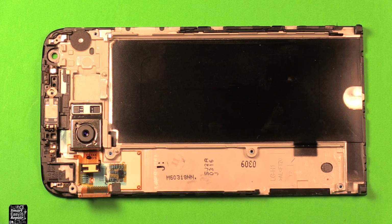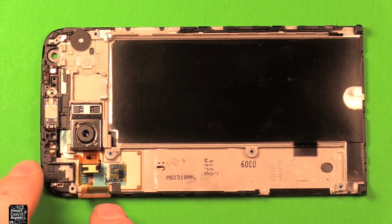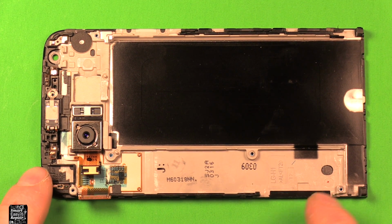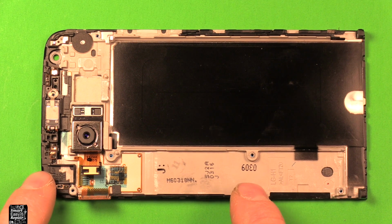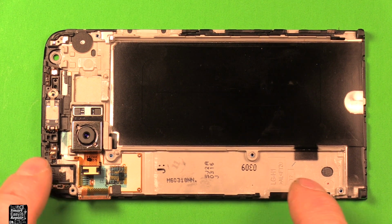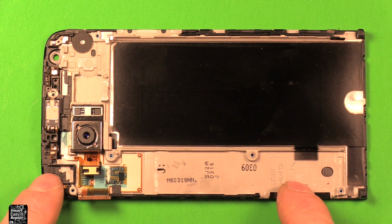Now to change your screen, the only thing that you're going to need to swap over is this rear camera and this earpiece speaker. Everything else, if you get the one with the frame, it should be easy to swap over. You're going to want to get the one with the frame. I'll link to that in the description of the video. Yeah, get the one with the frame because it's so much easier. It's all one piece. You don't have to worry about gluing and all that stuff. You can just swap your parts over and you're good to go.